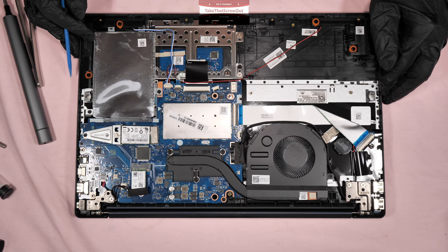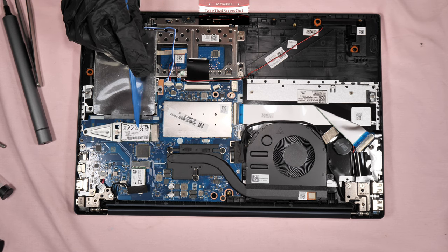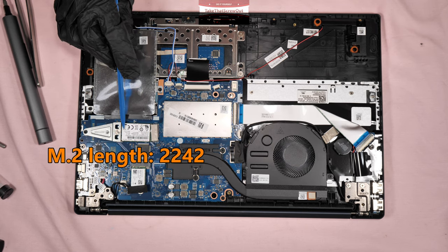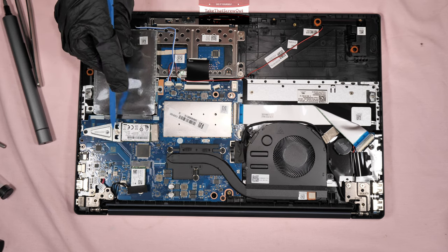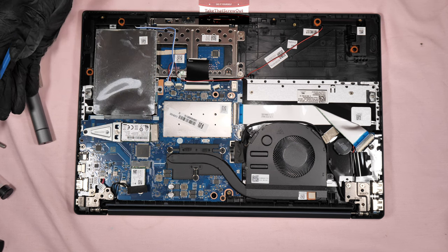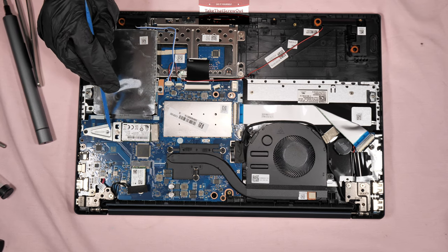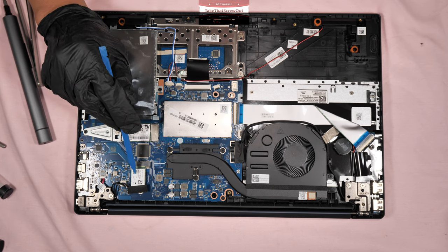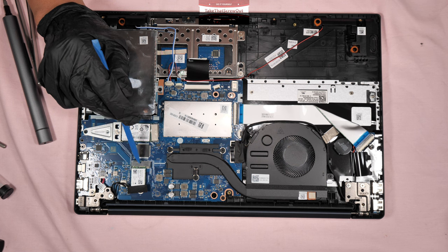These are the upgrade options on this laptop. The stock SSD is an M.2 SATA SSD, about 2242 to 2245 size — the short one or middle one. But you can use an adapter to fit a normal 2280, the long one. If you upgrade this M.2 SSD, you can only use a SATA M.2 SSD. The Wi-Fi, the stock one, is not the normal PCI Express size.